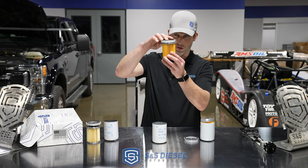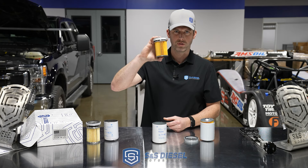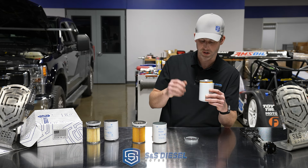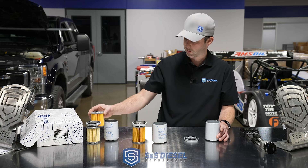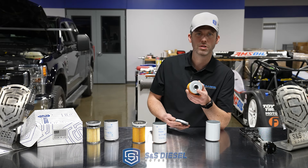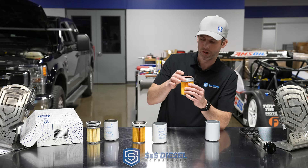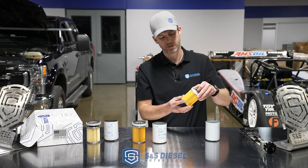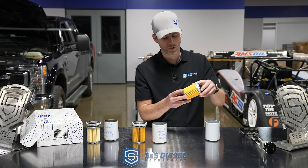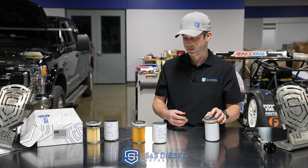Either way, we'll show a close up of this — you can basically see daylight through the bottom of this thing. Dirty side, clean side, daylight through the middle. This isn't going to seal at all or do any kind of good filtration to actually do its job. This is from the other kit. They at least didn't attempt to make it look legit too much. Another canister — it's actually smaller and shorter, so it doesn't have as much filter media or catching capacity, but it's not the end of the world. However, there's no seal at all up top either. It's metal to metal. At least in this case there's a little bit of a ridge, but it's sealing with just a little bit of metal contact and wishful thinking basically. There again, it's not going to do a good job of sealing the clean and dirty sides away from each other. It's pretty well a joke as a filter. A decent attempt at trying to make them look good, but a hilariously laughable attempt at actually making them function well.